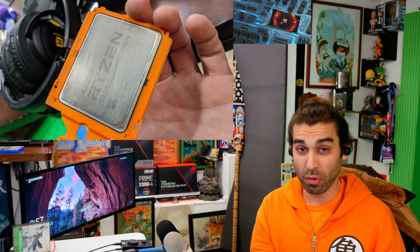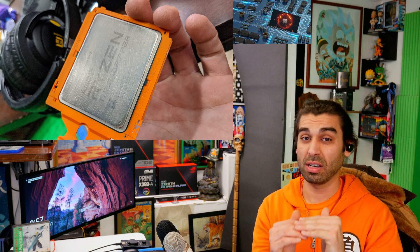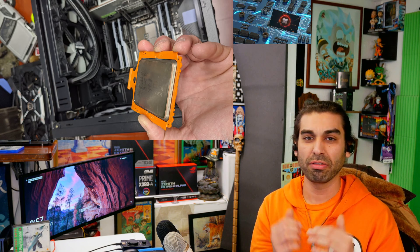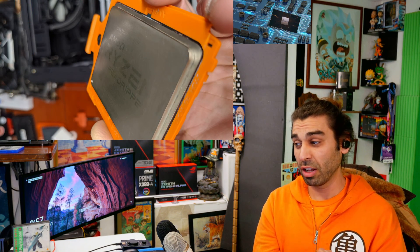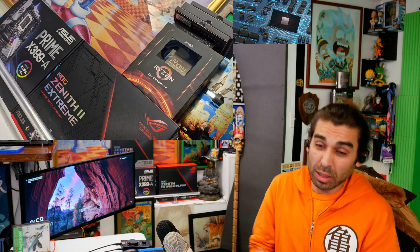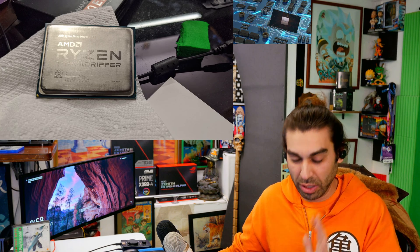This was successful because I was able to gain really good overclocking headroom. The temperatures are now lower, very consistent and steady. Before, it was very temperamental, and now I finally have the temperature and headroom I want. I can even make it better — I'm going to make a follow-up video on how to mirror-finish it, which should give a little more headroom and look really nice. If you want to take the bravery, understand this voids your warranty. The reason I did this is because I want all die cores running consistently, not one running hotter than the others.